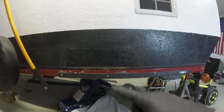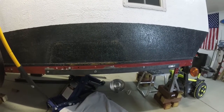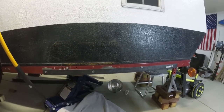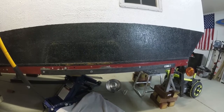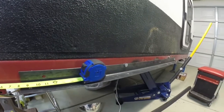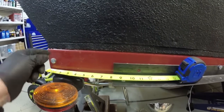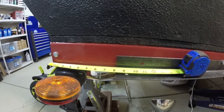We now have this much longer leaf spring hanger bracket holder in place, bolted in four places on the top and four places on the bottom. My question is: since the measurements from the rear of the trailer to the rear spring hangers were exactly the same on both sides, if I take this piece of metal and line it up with the undrilled side, can I just mark those holes and drill them so they bolt right in? I took the left side bracket, brought it over, matched up the two bolt holes, and it turns out it's exactly eight inches to the hair from the back of the trailer to the back of this angle — exactly the same as the other side. So I'm just going to mark the holes, drill them, bolt the second one up, and go from there.